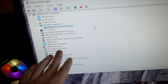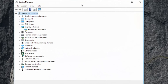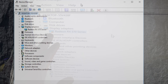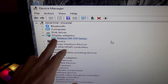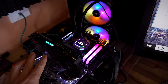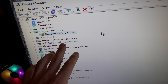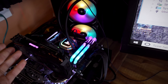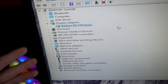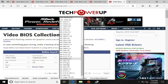The first thing before we even get into the gaming benchmarks is that the graphics card driver won't install — whether we get the old Windows driver that comes with Windows 10, or we try to download the latest AMD driver. We'll see it does bring up an exclamation mark in Device Manager. This means it's most likely got a different VBIOS, and in this case, this card was used for cryptocurrency mining. Whoever updated the BIOS put on a mining-optimized BIOS, which renders this card essentially useless for gaming in its current state.